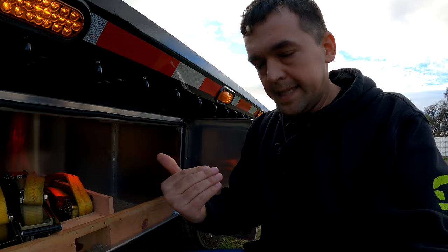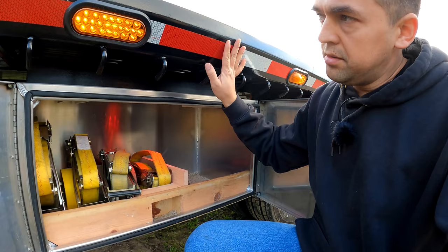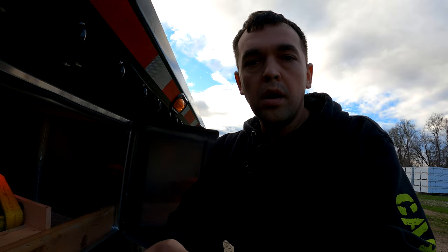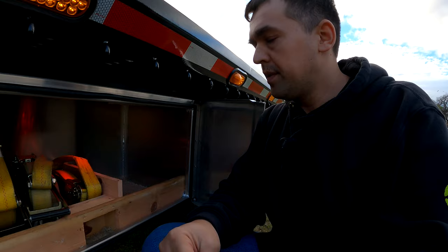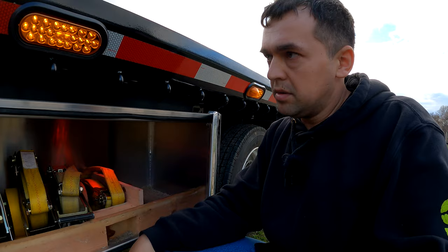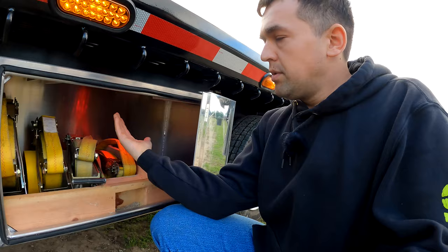It's much less likely that you would hit the truck with a forklift because you can see the truck. I tie these in electrically to the side marking lights, so that way if somebody forgets to close the box and you see a red light on the side of your truck, you know one of your toolboxes is open. It luckily has never happened to us yet, but that is one thing less to worry about. I used to use switches, but they went out all the time — it's a harsh environment for them — so I just tied into the parking lights.